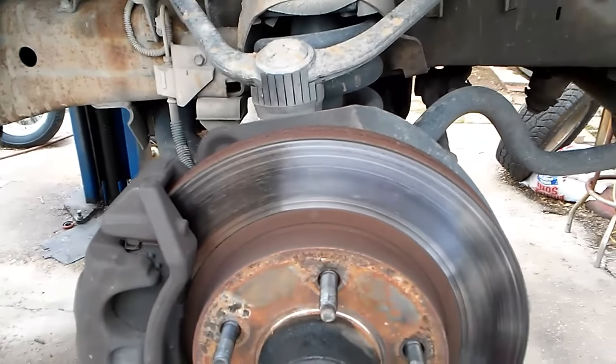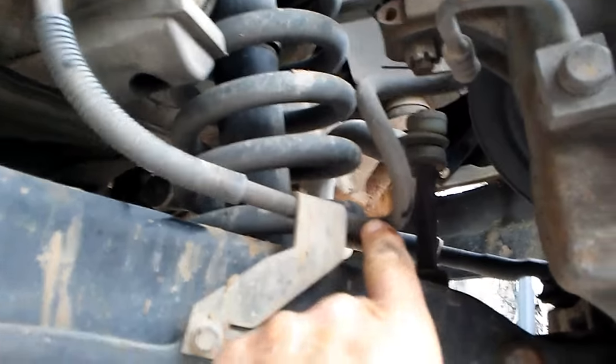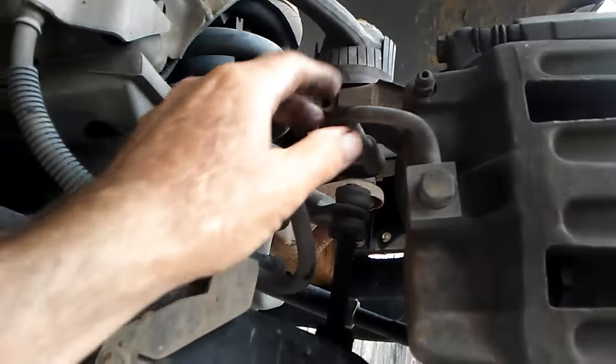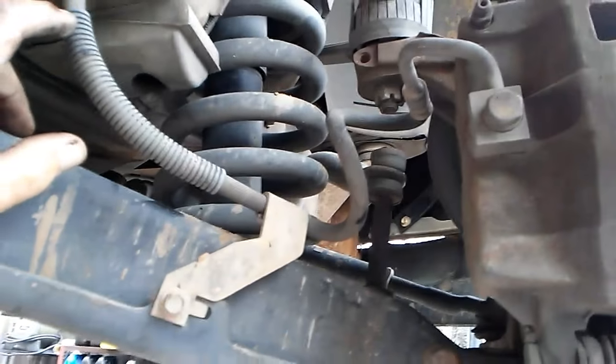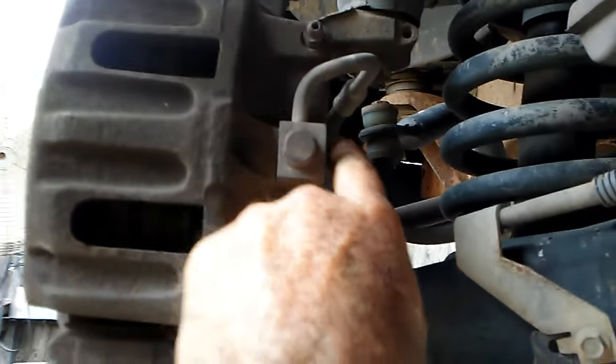But this is what I found. I started looking at the brake hoses and I found this one — this right front brake hose. This right front one is twisted. Apparently when the caliper was taken off, this line got all twisted in a loop, where it's dang near shut the fluid pressure off up here. This one's coiled up — the line should be like the left front one. See the left front — the brake line isn't all coiled up like the right front one, it's more of a straight shot there.